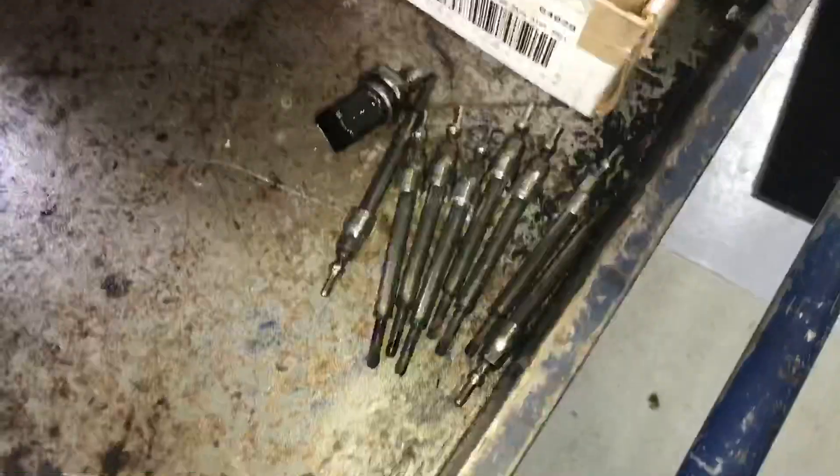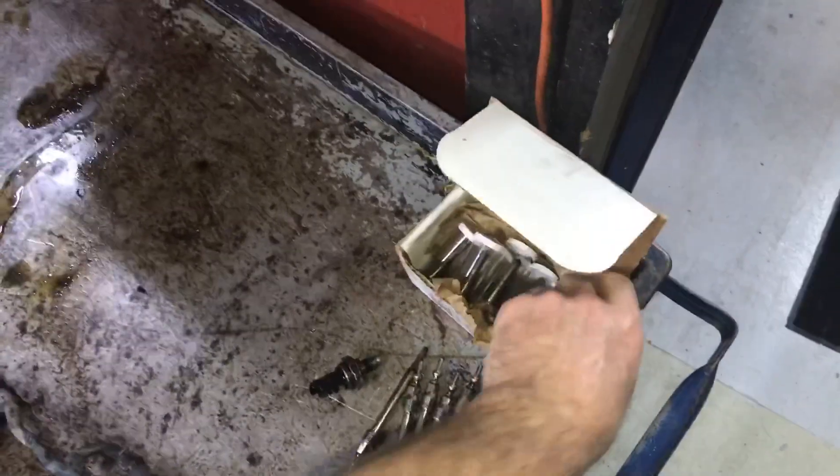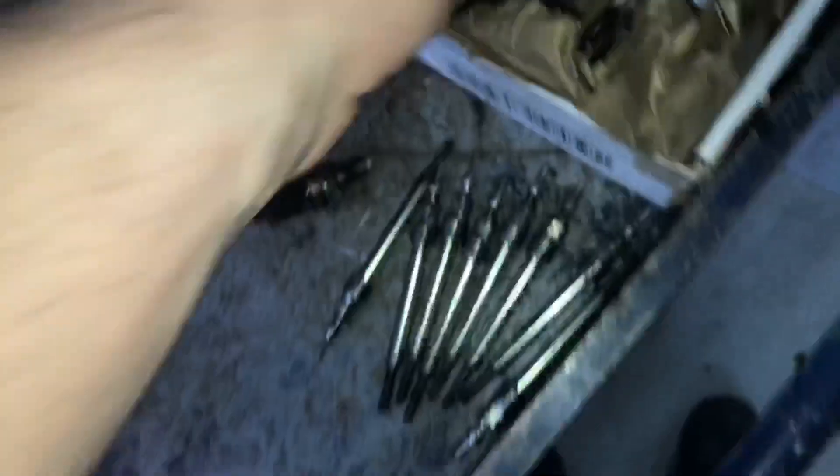Here's all the parts right here. We're gonna put new glow plug wires on it, go ahead and do the glow plugs. We yanked all the nozzles out and we're gonna take the fuel rail sensor out too. It's like 30 bucks for a fuel rail sensor, and when they do go bad it will cause a funky idle. We did put all the nozzles in.